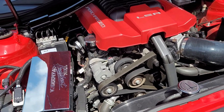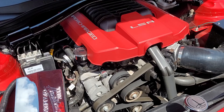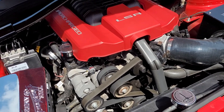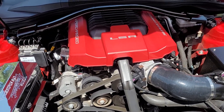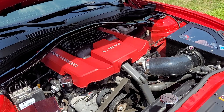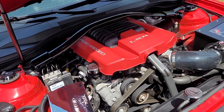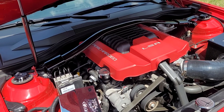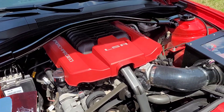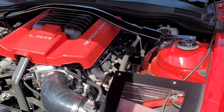Other stuff I might end up doing is dressing up these pulleys. If you've got one of these cars you're going to replace your upper and lower pulleys with upgraded ones — it gives you more horsepower and looks better. I think I can upgrade the pulleys before I have to tune it, but anything after that you're going to have to tune it. Even if I do long tube headers, eventually you'll want to tune it anyway. And you'll have to start upgrading injectors, ignition, and fuel pumps — depending on how much horsepower you're going for you've got to start upgrading some of the internals. I've seen people upgrading intercoolers and adding ice water boxes. The mods for these cars start to get out of control.